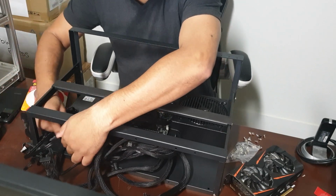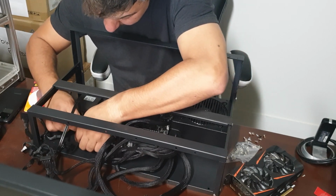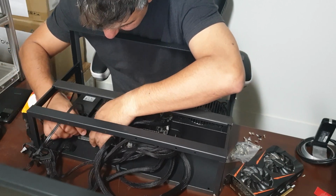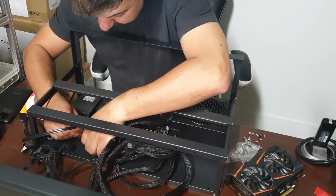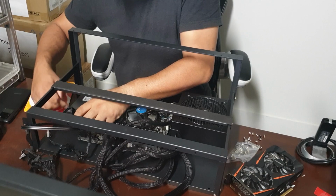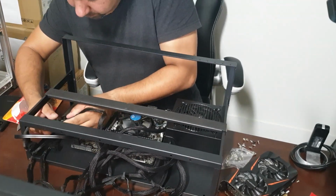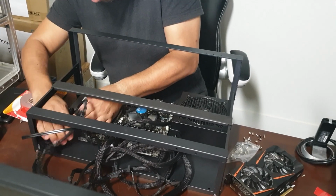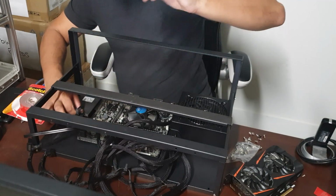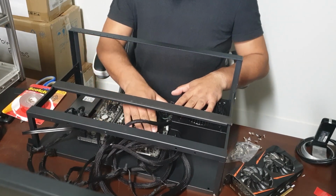Like that, and you can connect the SATA port of the cable to any of the SATA ports on the motherboard. It doesn't matter. Because I have access to those. Just like that. And then obviously we need to power it as well. There we go, that's powered. Okay, so that's the SSD done. It's connected correctly. I'm just checking. Yep, rammed in. Okay.